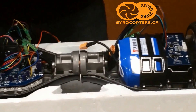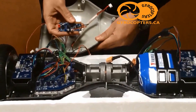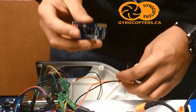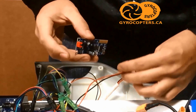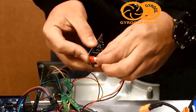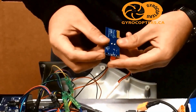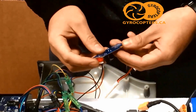Next, we're going to make the connection to the Bluetooth board. The Bluetooth board is on the bottom casing — it's just a small circuit board. You'll notice there's a red plug and a white plug. The red plug is for power and connects directly to the motherboard. The white plug is your speaker output. Please take note of each plug and make sure not to connect the power into the speaker output, as this will damage the Bluetooth board and possibly the motherboard as well.